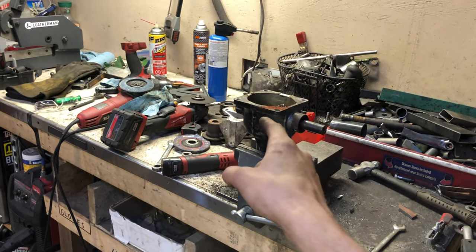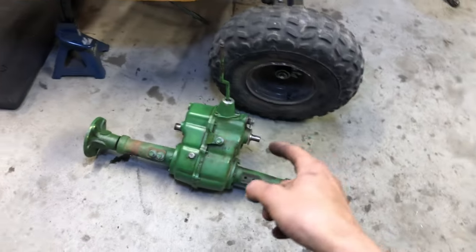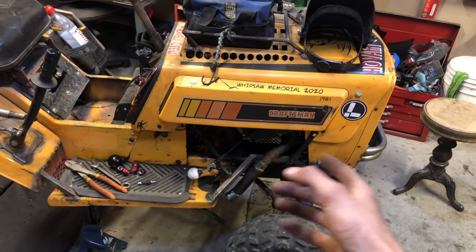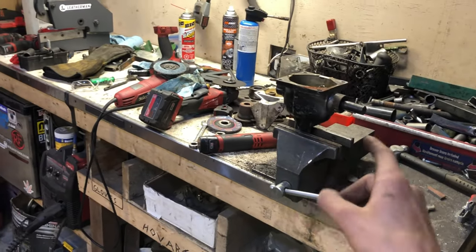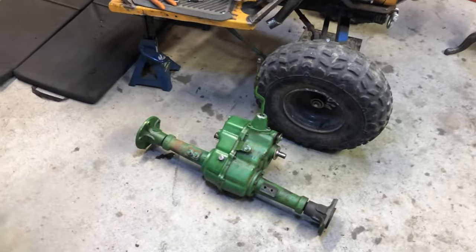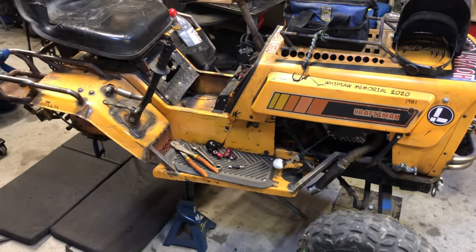It's about one turn for input is 3/4 turn output, and then there's obviously gear reduction in there, and there's pulley reduction, gear reduction between the pulleys and stuff. So I got some math to calculate, but I did a little bit of pre-calculation. I think I got a close enough setup to where I can start building and mocking stuff up for a belt. But it is very complicated to figure out ratios and stuff.